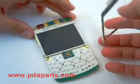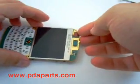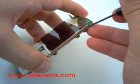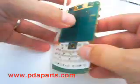You are now able to remove the front bezel off the LCD, which will allow you to get to the LCD. Lift up the ribbon cable holding the LCD in place. Now you'll be able to use a small screwdriver and remove the LCD — there is a little bit of tape holding it in place.